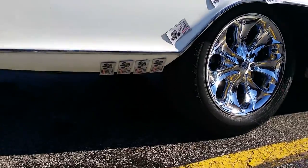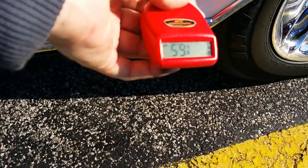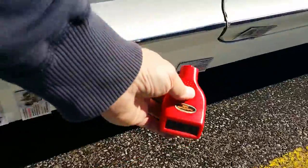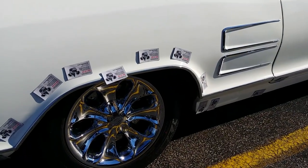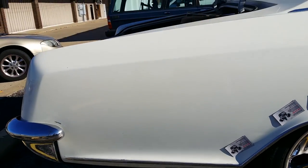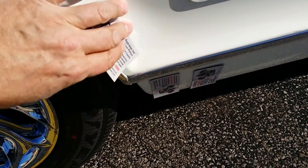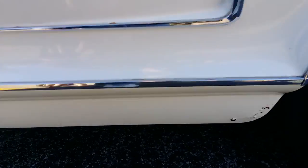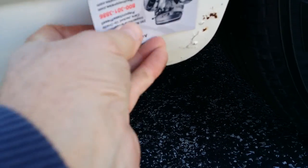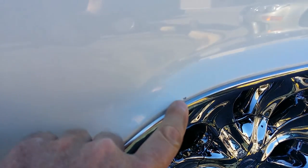I've moved around the car with a digital paint meter and laid out some magnets all over the vehicle. The car's got very good adhesion — I'm getting 16.5 mils in one reading and 6.0 in another. Door corners at 6.0. These are refrigerator magnets; they'll stick up to about 15 to 20 mils. That's pretty consistent for the whole entire car. There's a little bit of filler right here in this corner, but a magnet still sticks. There's a little bit of repair work underneath the paint, and down low on the driver's side there's a little bit of repair work that's popping out, but it tested out okay with the magnet. A few various chips in various locations.